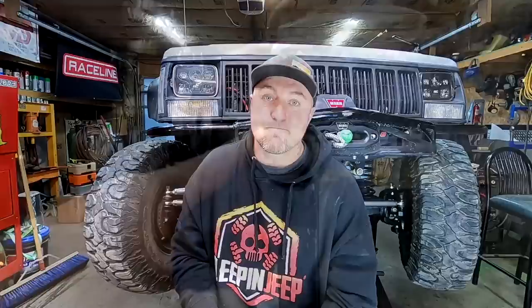One thing to be careful of: when steering full lock, you should back off anyway, because holding it full lock with the pump whining is going to wear your pump out and with hydraulic assist the ram tries to pull in even more — you could actually break stuff. So just don't hold full lock. Alternatively, put a spacer in, or in my case I'll just drive smarter. Hopefully later I'll find that pitman arm and have the full 8 inches of stroke.